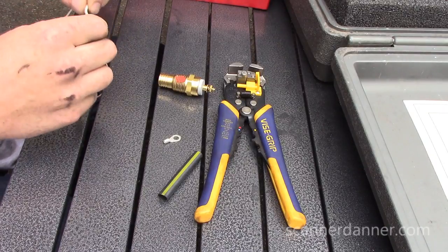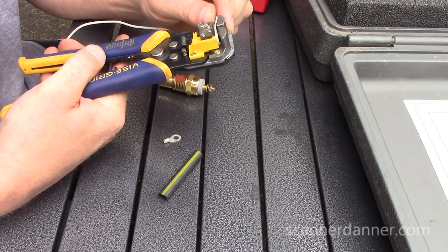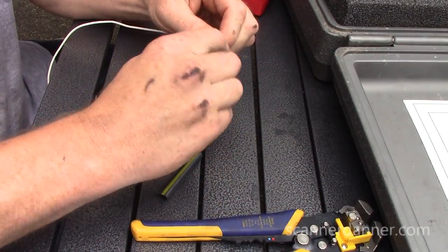Cut that wire and we'll adapt another circuit for our new switch — that's all it is. It's an overheat light, just added safety while on the road. Let's say the water pump fails — maybe before my temperature gauge would climb, the overheat light switch would trip and give me a warning, protecting my engine. What if I have an overheat condition that's delayed on the water temp gauge? I don't even know where they put the water temp gauge sensor, so that would dictate whether this repair was even necessary — but I want everything to work like it's supposed to.